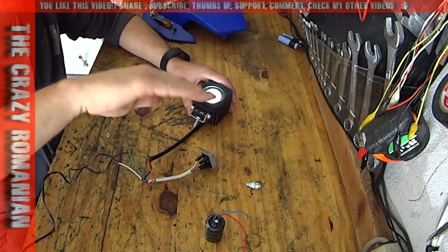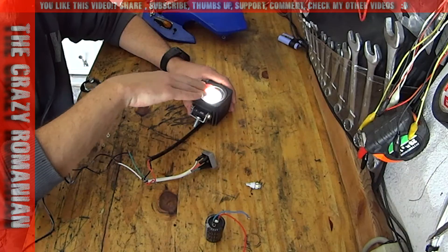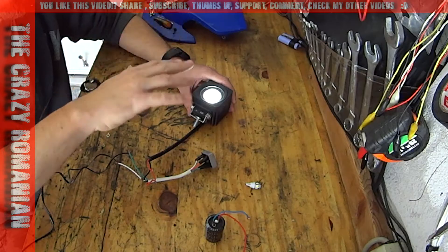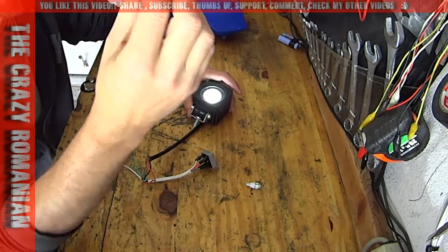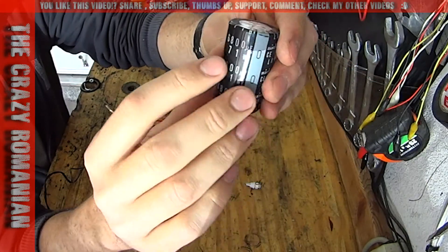Because of the wave conversion from AC to DC there is always some loss of power. The LED light cannot burn brighter, so what it does is dim and then come back — it dims, it comes back. How do you fix that? You can fix it with a capacitor.